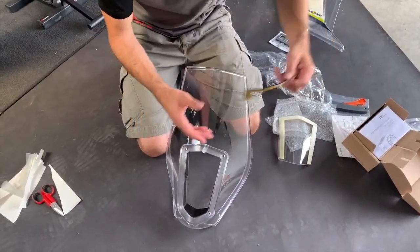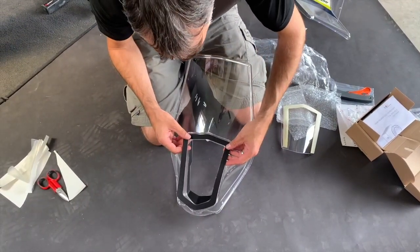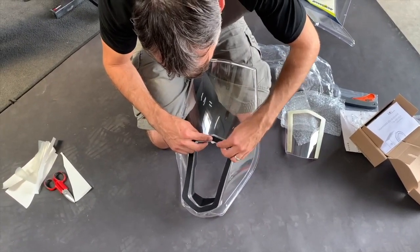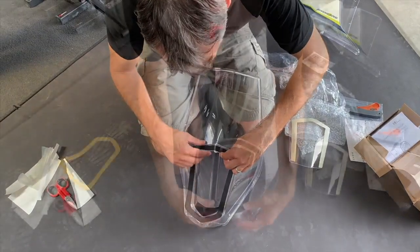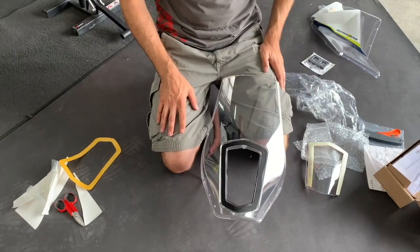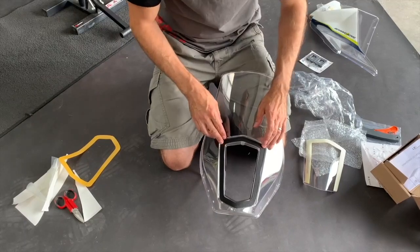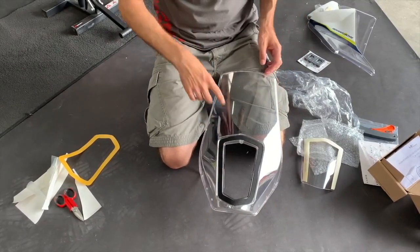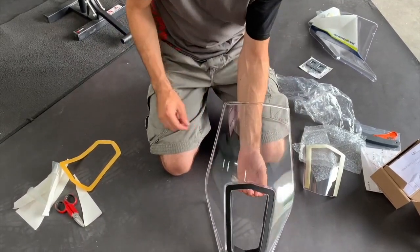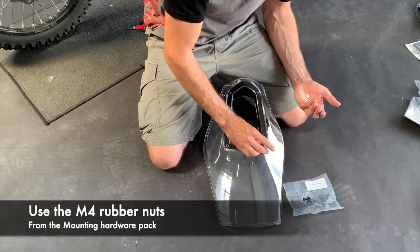The next step, you take the mesh, and you stick it around. What we suggest, you start here, the top middle corner, and you go on both sides. You see, we have covered the holes now. The point is, if there were holes, you would never fit it correctly on all 4 of them. So now it's good to take a sharp knife, or drill, and cut again the holes into the windscreen.